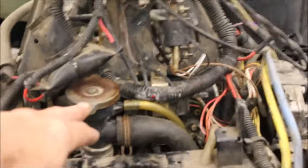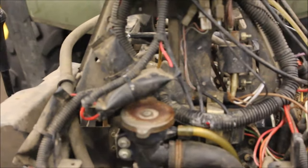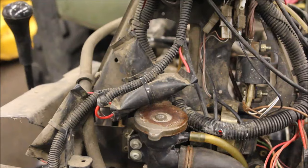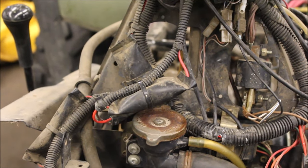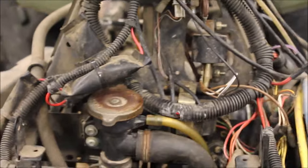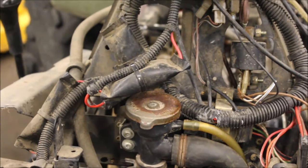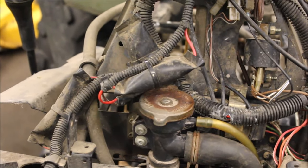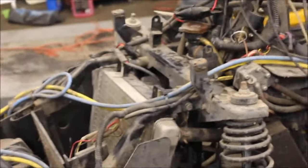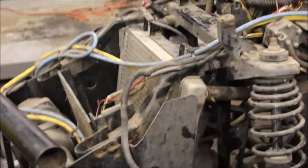What I'll do is take the radiator cap off, fill it full of coolant, and squeeze the hose to get the bubbles out. Leave the cap off and run it for five minutes. Once it gets up to around 165 degrees, the thermostat opens and it'll burp — a little coolant will pop out, it'll suck down and you'll be able to see it flowing. That's how I bleed the coolant system. Another method: a lot of guys will lift up the front end of the whole unit — ride it up on some steps so it's on an angle — that way all the air from the bottom of the radiator comes to the top and circulates out.